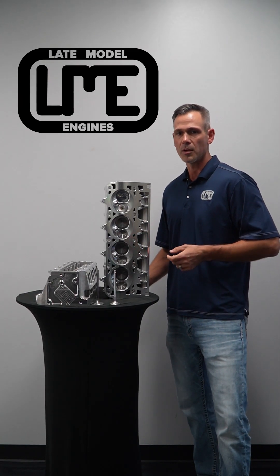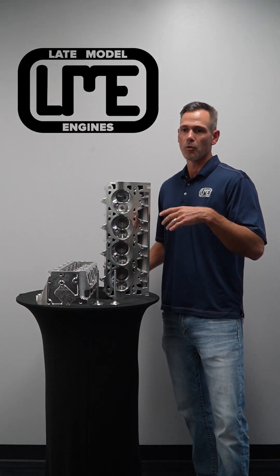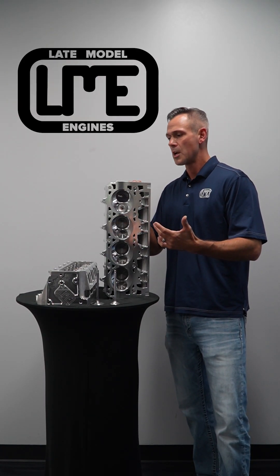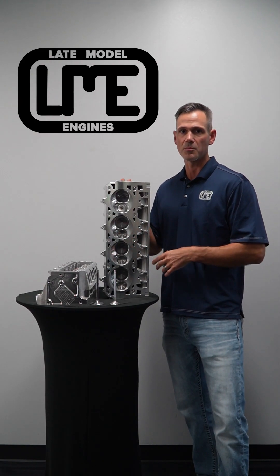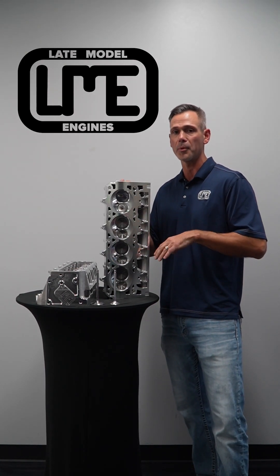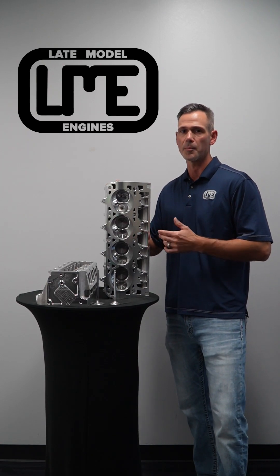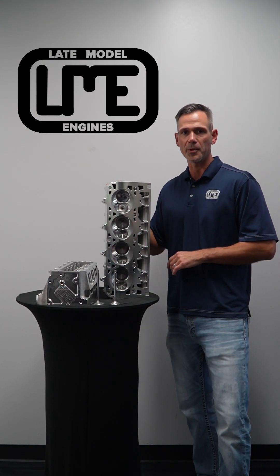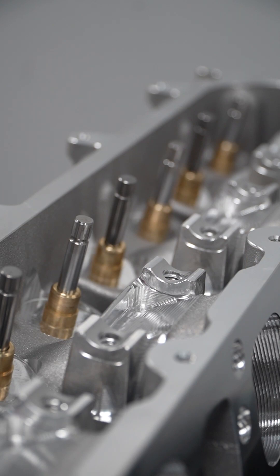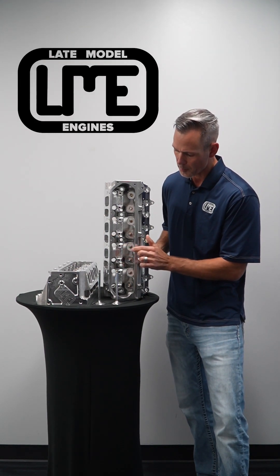Valve springs can be set up with all your standard hydraulic roller and small diameter low lash and solid roller springs. Rocker arms can be configured with the factory rocker arm and any of the aftermarket bolt-ons. For the racer, we have a shaft mount Manton system that's really nice — it runs a staggered 3/8 pattern to increase the footprint and clamp load on that rocker stand, and it's a steel rocker intake and exhaust. That's going to be used in sustained RPM, real high boost applications where the exhaust valve is really under a lot of stress — your ultimate race setup. On the factory rocker, we included some strengthening gussets to tie in both the intake and exhaust rocker on each cylinder.